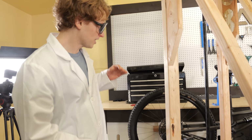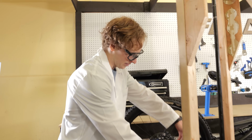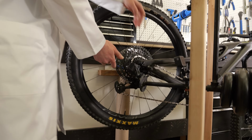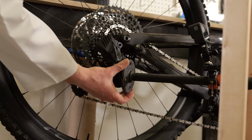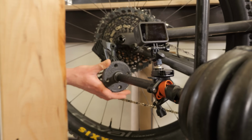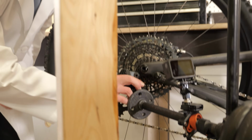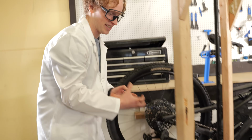We can't believe that this thing is still running just fine. So to mitigate these things, where we're seeing this thing slipping past the derailleur after the initial impact, we've added our wide flange lance tip to cause maximum damage here. This will ensure that once the derailleur moves out of the way, it's still in the impact zone.